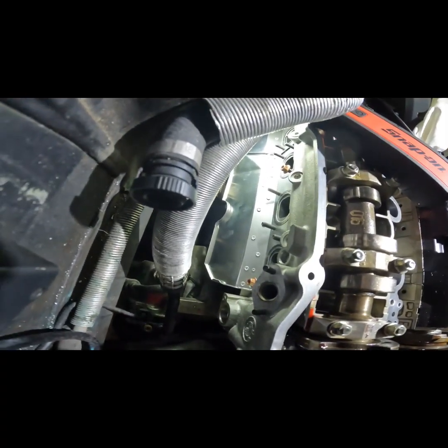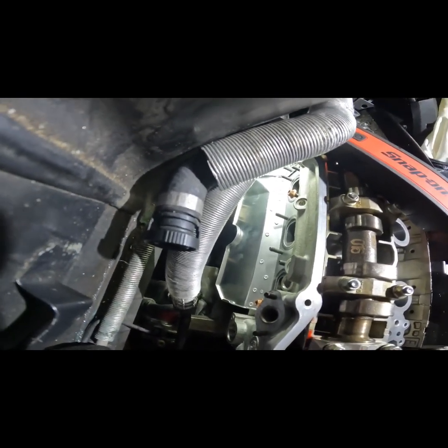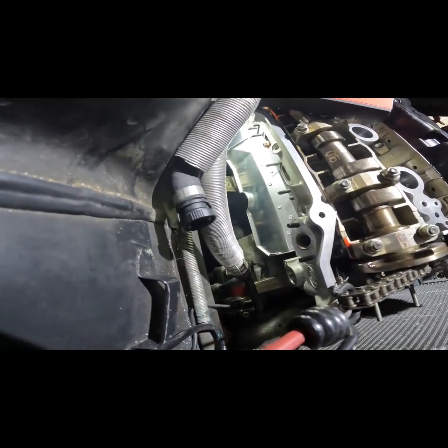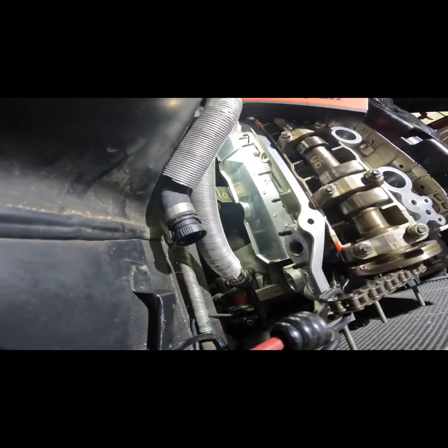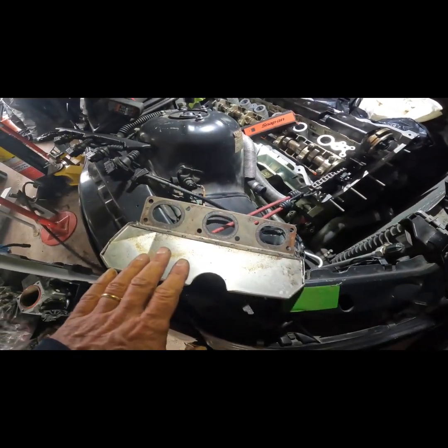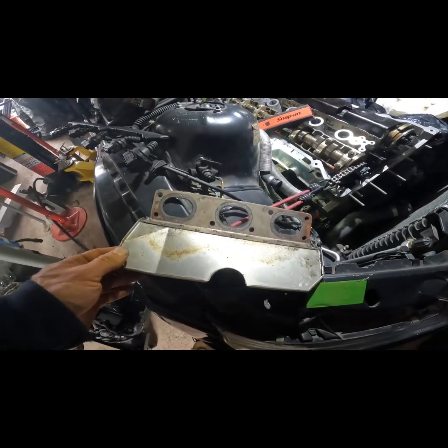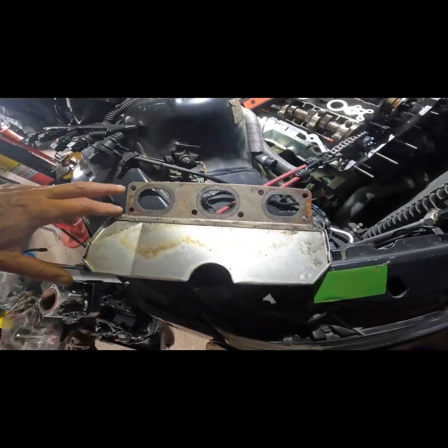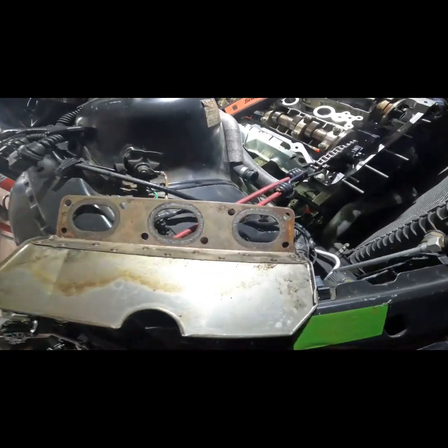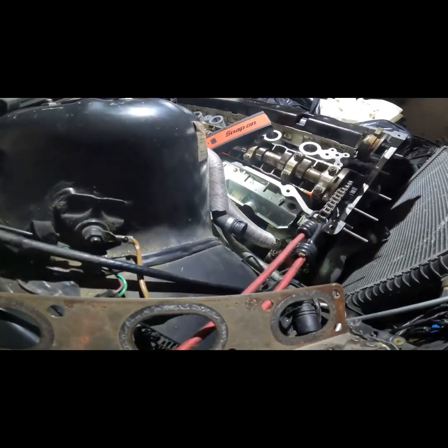So what I did was remove some of the studs. If you're following my videos, I had actually put studs in all of the holes, and that was just being overzealous because I forgot that not all of the holes are used. So you only need two, four, six, eight studs, and you have to install them in this pattern right here.